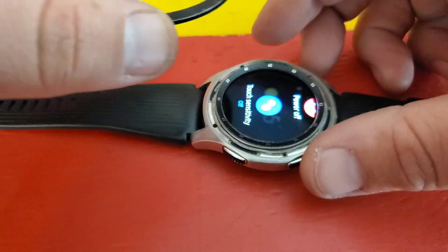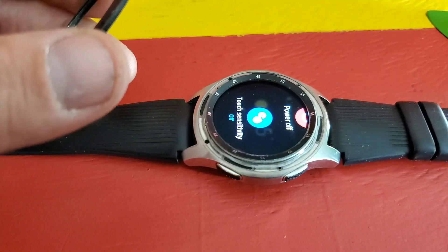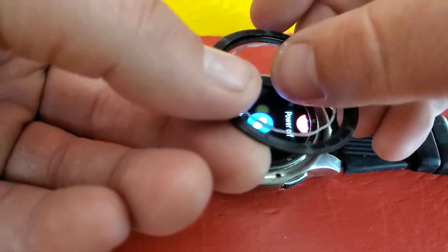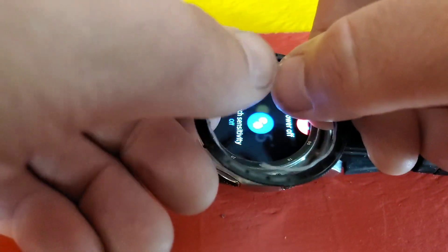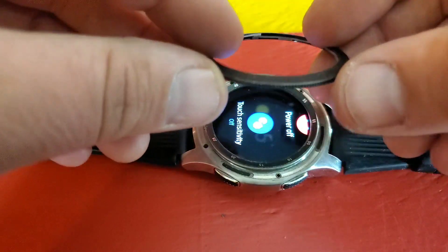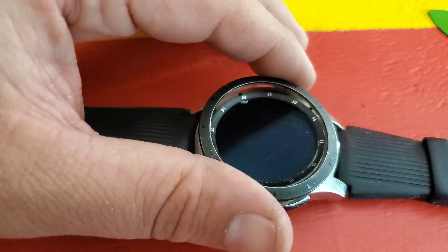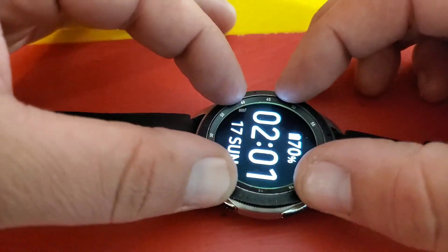You might want to watch the other video to make sure you get this gasket ring in place. What I should do now to make it easier — because it doesn't want to pop down real easy — is take this gasket ring and pop it out. Mine's a little dirty. You put it in the grooves in this thing, just on the inside groove, just like that. See how it's kind of just fitting in the groove in there? You get it all in there, all around — you get it to sit in there. And then it should pop back on a lot easier. It's got a little piece sticking out — it's not that easy. You're dealing with small stuff here. Let's try that again. There it goes — you hear it pop into place. It's good now. There we go, it's back together.